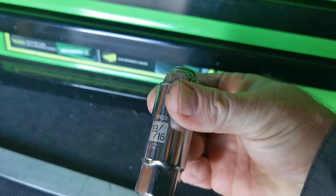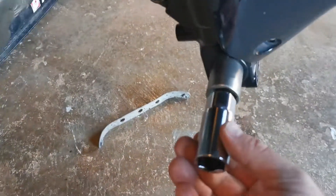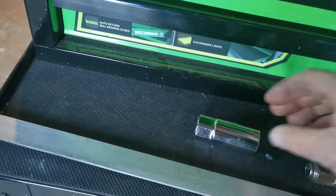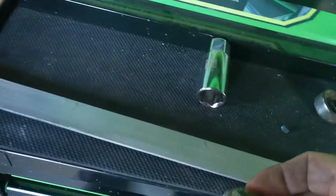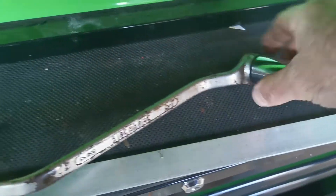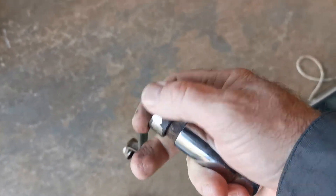The tool I used for that was this beast. I got an old 13/16 spark plug socket which fit nicely in the end of there. You could slam a set of multi-grips on there and undo it, but that tire is nine years old — that's the reason for changing it. What I did was find a wheel nut, a reasonable length one, so one end goes in the bike, and then the wrong end — go the right end — into the ring spanner. Could have been a socket wrench or whatever, and there's your tool. That easy.